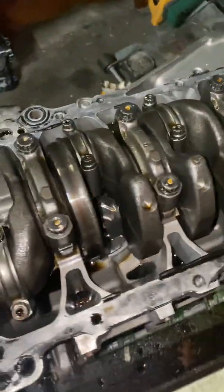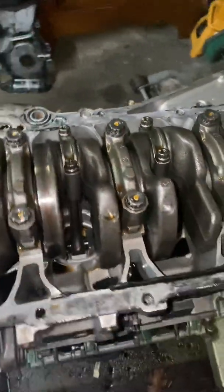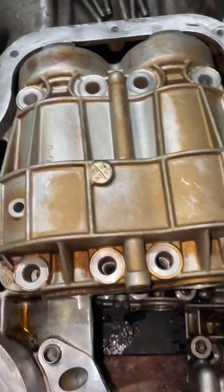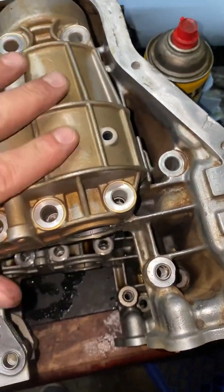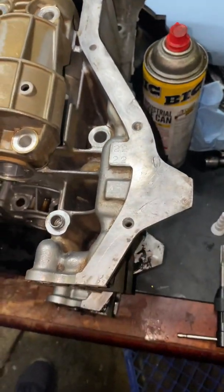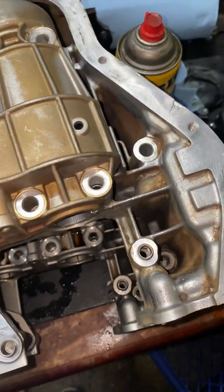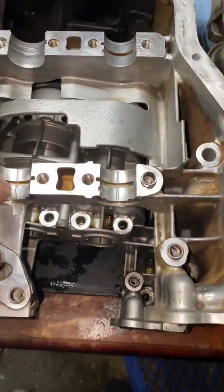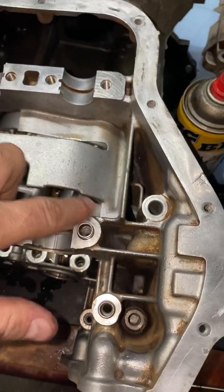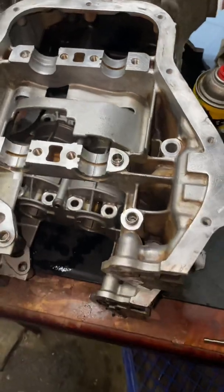Once that's off, you have it balanced and you'll be good to go. But that's not it — then you come to the crankcase. This is the crankcase, and underneath this housing is where the gears normally sit. I've already removed mine, so I don't have the gears, but we take the cover off. And you can see shaft one, shaft two. There's two gears that sit here with counterweights and it spins and keeps it all in balance and keeps it smooth.